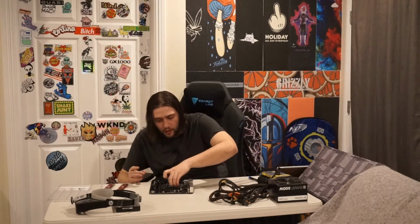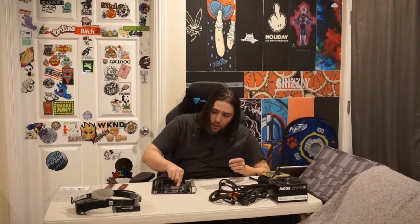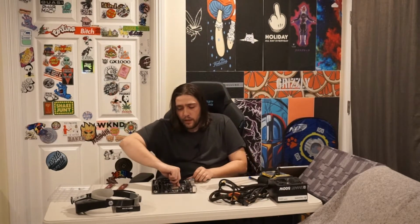That's fine. We're good. As I was saying before, you match up the triangle with the one on the motherboard. And you gently just let it fall right into place. Just like that, you put the retention arm down and ta-diddly-paw, tis done.